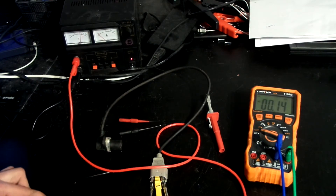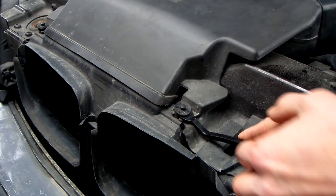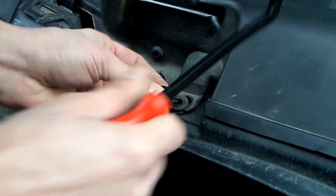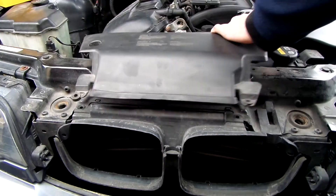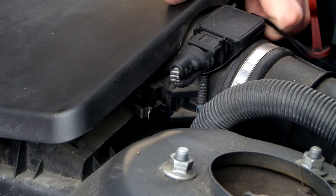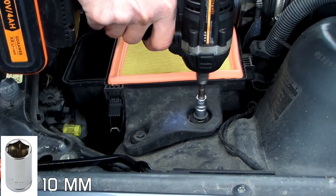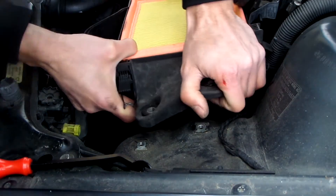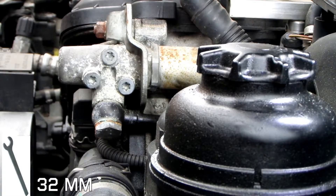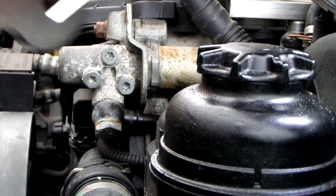The actual test pulling the 5V to ground would be a bit more challenging. I'll be showing the change on an E46, but the process is similar to any BMW with this engine. Take off the air intake and air filter housing. Disconnect the VANOS solenoid and remove it — you will need a 32mm wrench.